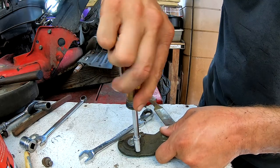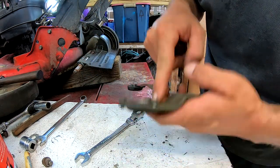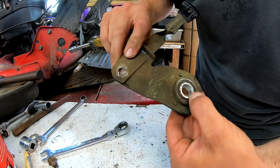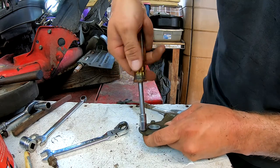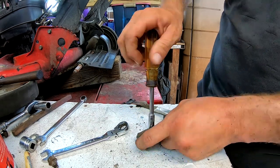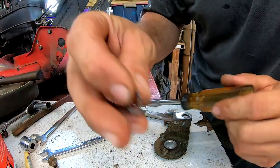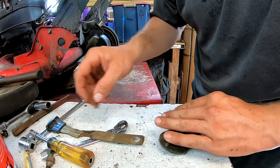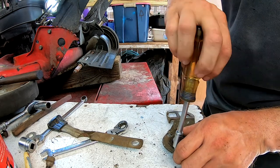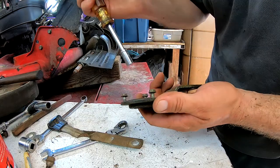It's kind of the same idea you would use for ball joints and so forth — just run a large-diameter two-piece here and then use your vise. This one's not too bad but it is kind of crusty and granular, so we're going to go ahead and just replace it. We're here, it's up on top. Actually I bought four — we're going to redo my backup mower as well. There's also this extra little clip to put on the back to secure it. You could probably just hammer it too, and you could use some PB Blaster ahead of time to make it easier.